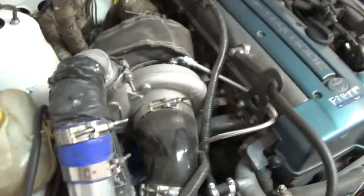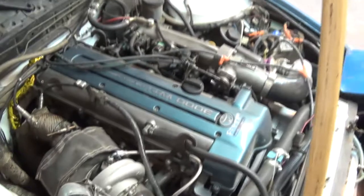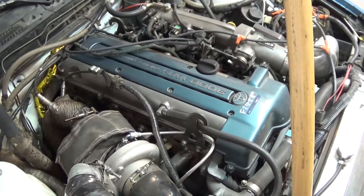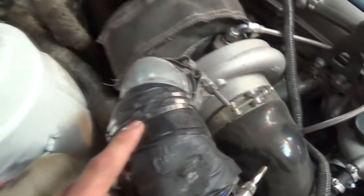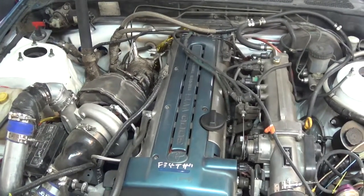There's the engine mount down there — you can kind of see that black bolt head, and there's a nut on the other side under the subframe. Both sides loosened up a little bit, so the engine was rocking back and forth. I tightened them up before this IMI event and so far it's holding up pretty well. The kit did move my engine a little from my old setup — I think it sits a little higher and leans slightly. I had to trim a little hole in the hood so the engine would clear, and you can see it's still kind of beating the crap out of it. But my drift car is not a show car — function over form is my motto.